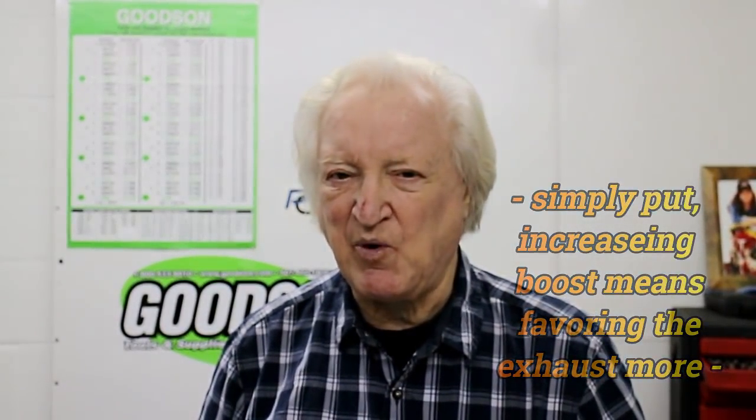In other words, if you had a 0.75-to-1 ratio for a normally aspirated engine, you might — with 20 pounds of boost going in — want to see something around a 0.9-to-1 ratio. The other thing is that if you are looking for good performance at low speed without necessarily sacrificing high speed, then good swirl is needed. Here's the problem: the style of head we're working with here usually ends up with flow at the expense of swirl, or swirl at the expense of flow.